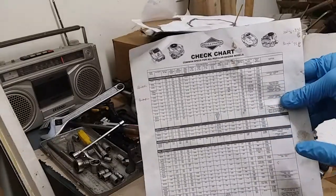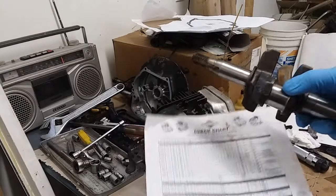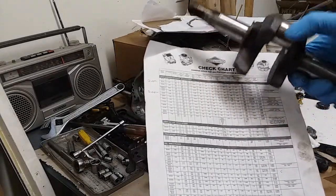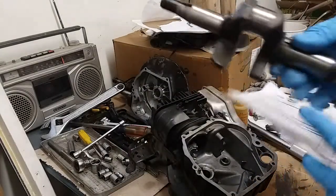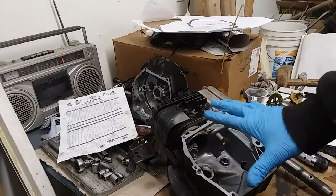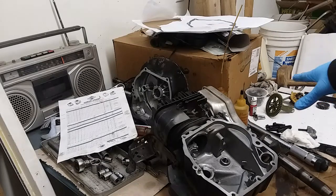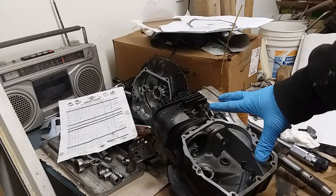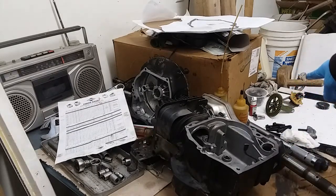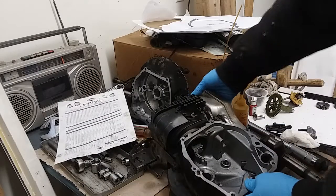What I'm basically going to do is swap the crankshaft out, also using these Briggs specs for these motors. This is for the Quantum motor - it gives you the dimensions to make sure your crankshaft is within spec. If the crankshaft was excessively worn and I put it in, you'd have rod knock. I've already checked this diameter here, the upper diameter and lower diameter. The bottom half of the engine - timing gear and everything else - and the sump itself will be from the old motor, because this timing gear mates up with that camshaft.